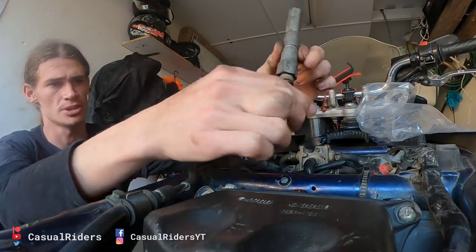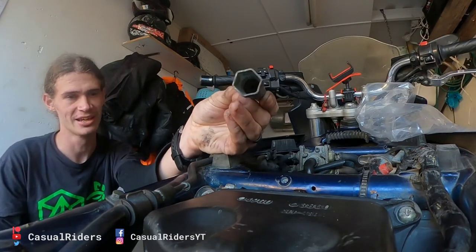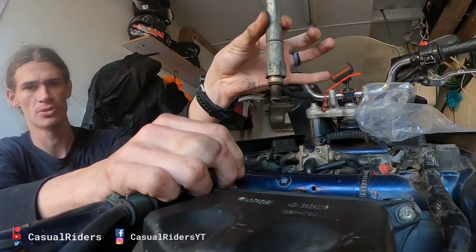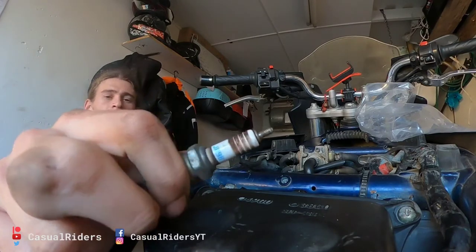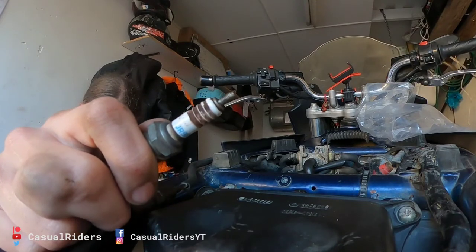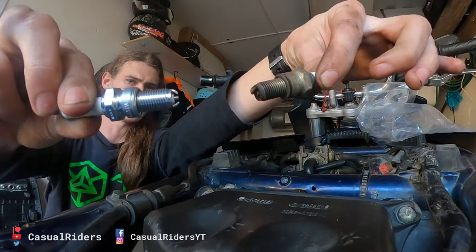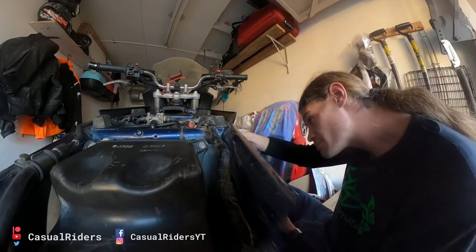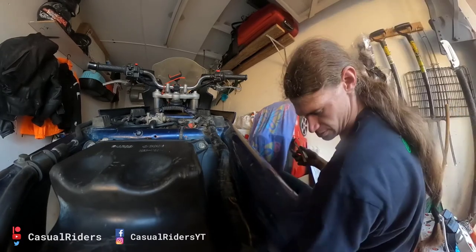What's really cool with this spark plug tool is there's like a little rubber piece inside there. Basically what it does is it clips onto the end of the cap, so as soon as it's on the spark plug it holds it in place and lifts it out fairly easily — except if that's damaged, which I've experienced once before. Then this removal tool doesn't work and you have to fish it out with long nose pliers — not easy at all. So the difference between the 9B and the 9C — there it is. Last spark plug is in and I'm putting in the last plug lead wire. Service: completed. It's that simple.